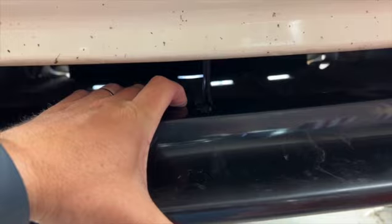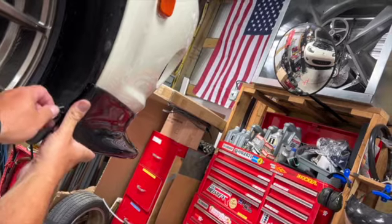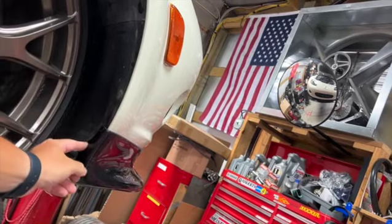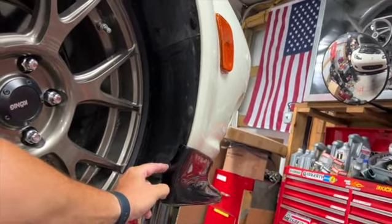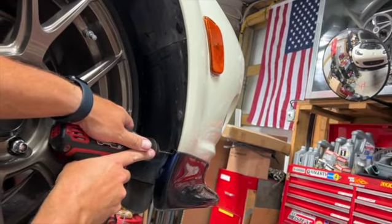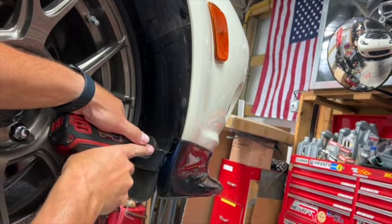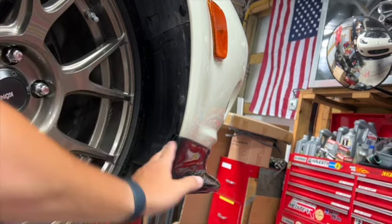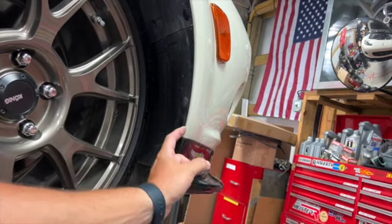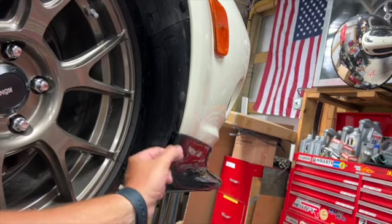May have to put a screw in here or from underneath — not sure yet. I'm using the existing hole for one of these grommets. I'm going to pre-drill two holes through both of the plastics. This goes through the lip and then through the inside fender lip, which is also made of plastic, and then I'll run the two screws that came with the lip into here.